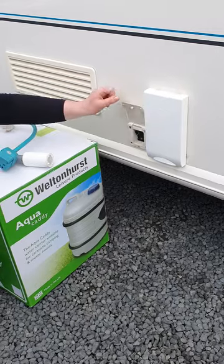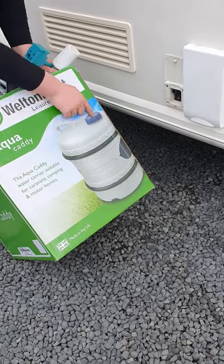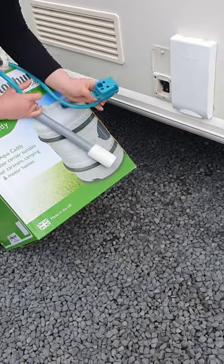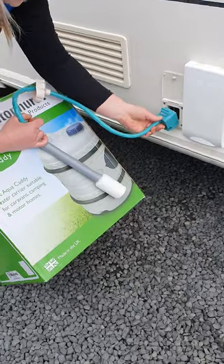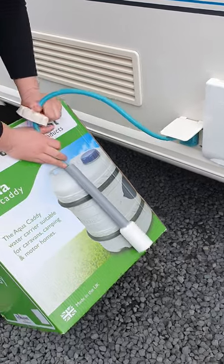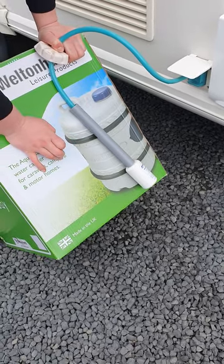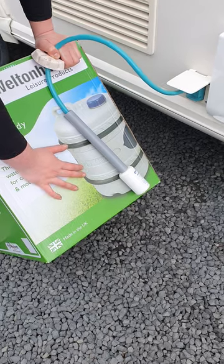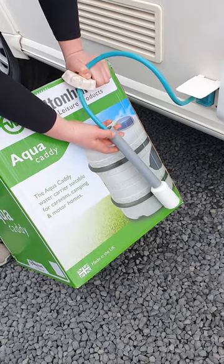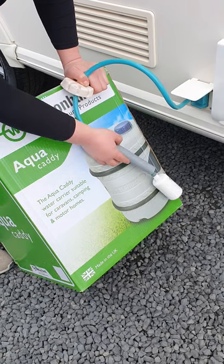Just next to that here is your housing unit for your fresh water. You've got your fresh water barrel — fill it right up to the top, bring it to the van, undo this top lid, drop your pump right down to the bottom. It does only go on the one way, it corresponds to the van; you push that in and it slots into the little cap here so you can drop that down to protect it. Once you've got that hooked up, you can then go inside and turn your water pump on. These water barrels don't have a gauge and there's no gauge inside the van for the level, so it's really important you keep an eye on it. You don't want it to get sort of quarter of the way empty. You do have a little piece of pipe on your pump — I would recommend keeping that on, it just stops the pump from curling up out of the water so it doesn't run dry without you knowing.